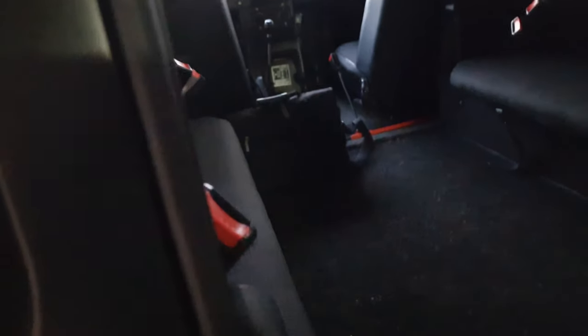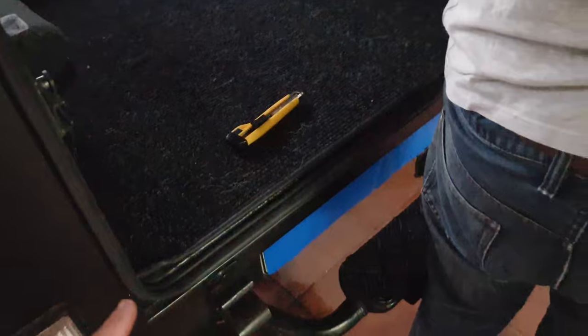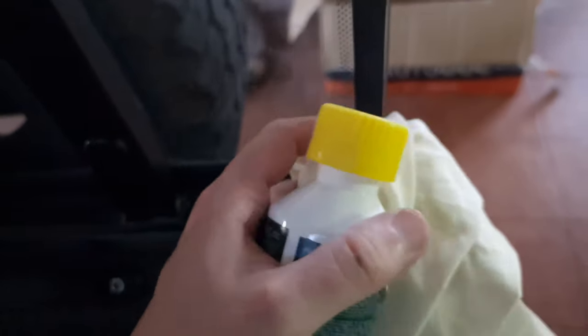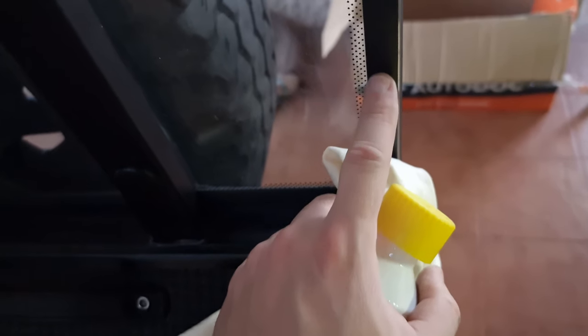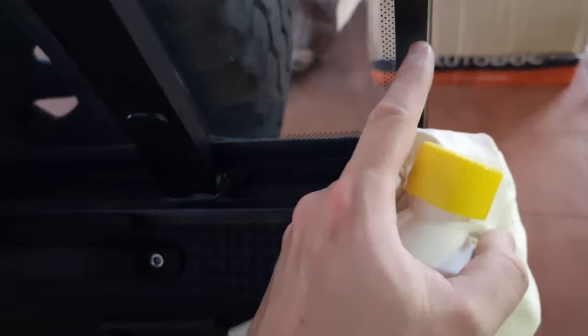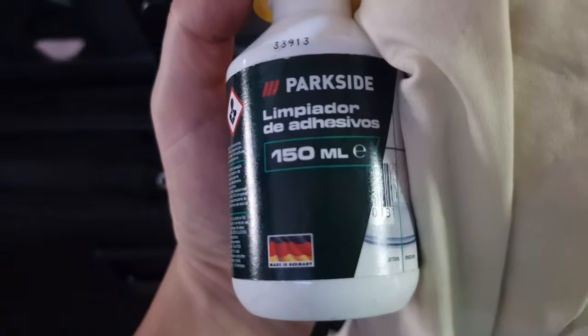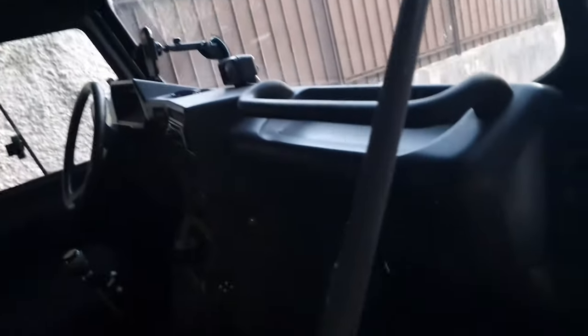We already got this rubber in place. I'm going to move to a more lit area to show you guys better. The rubber is already in place and it's closing perfectly — well, not perfectly because only God is perfect, but it's closing excellently. Now I'm taking out the old sponge that was on the window because the old rubbers weren't working, so I had a sponge there to keep rain from coming in. I'm using a blade and an anti-adhesive product that removes all the stickiness.